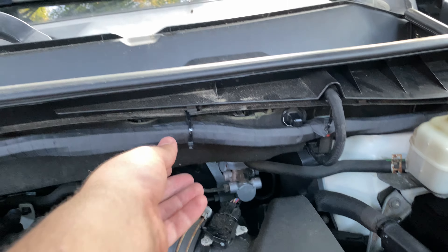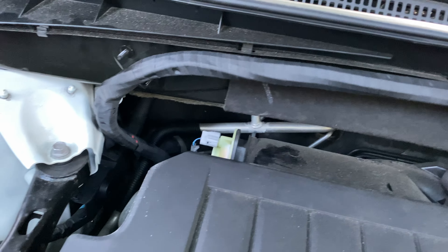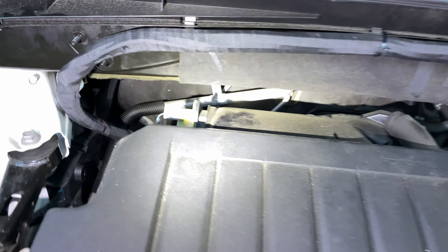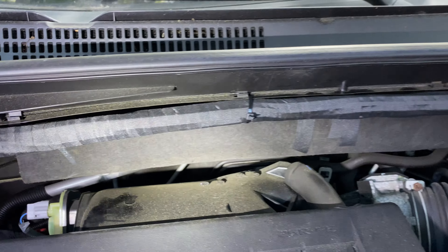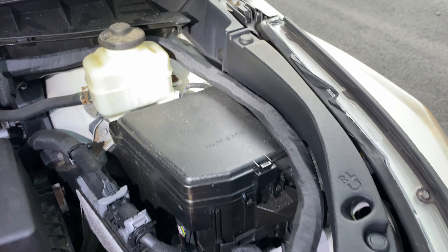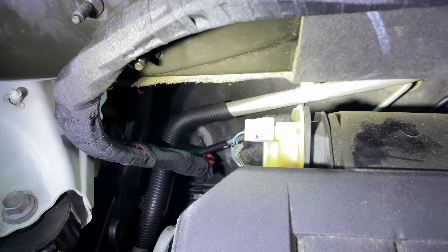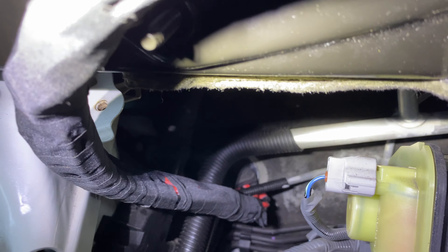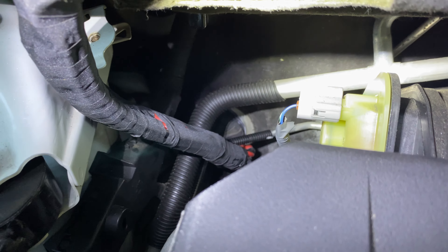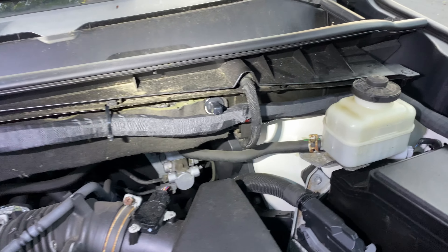I found it's better not to put it behind the firewall area — I put some clips to hold it in place and will add one more tomorrow. I tied up the wire, pulled it in a bit, and tidied it up. This part is done with the Anderson connectors. The fuses are still out so we can make the connectors on the inside. The engine block has a plastic cover so the wire is well above it — no interference problems. This is silicone wire, and it went through the grommet with the screwdriver technique and came out perfectly, running all the way around.